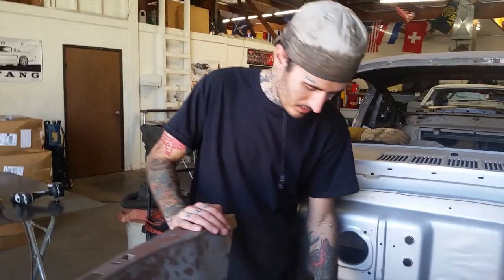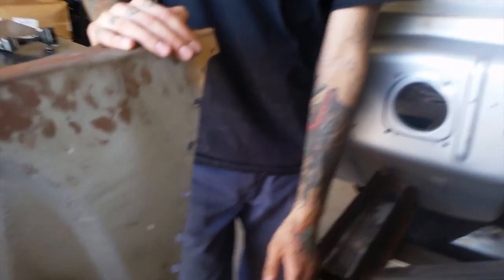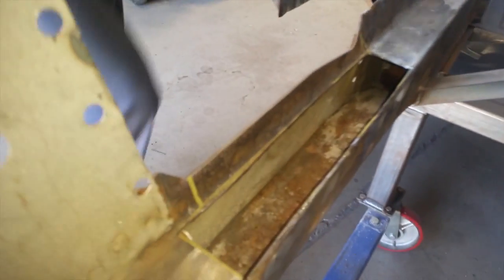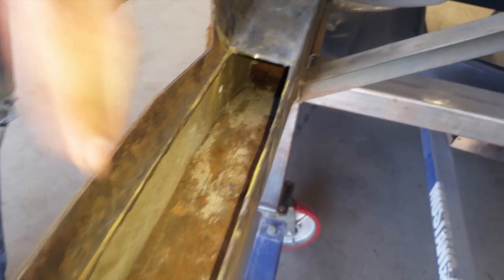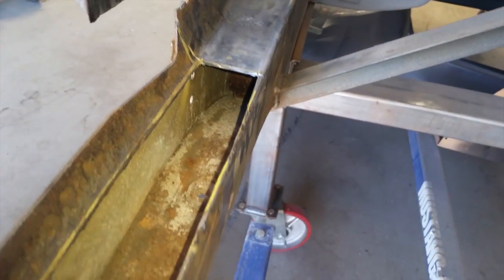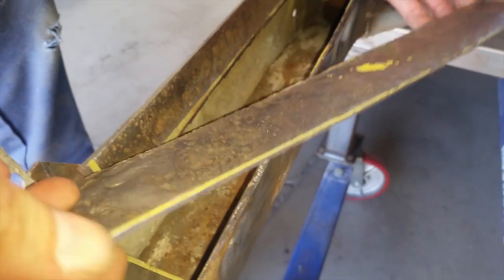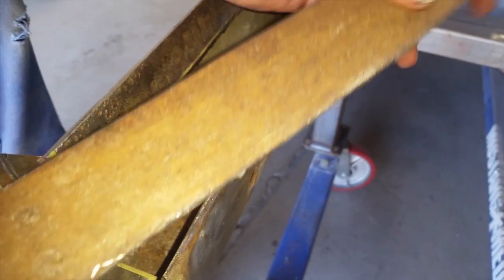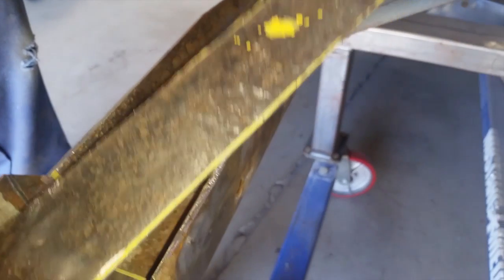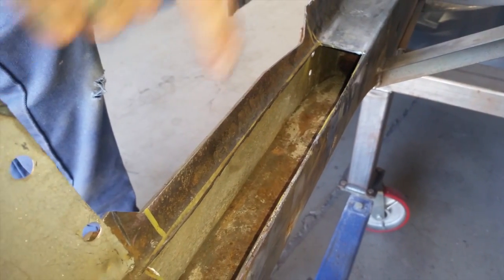Alright Casper, there's a little part two for you on the rust on your frame rail on the passenger side. We got a little look inside here before I close it up. There's rust of course, but it's nothing too crazy — this would be the inside of the piece that I cut out. There's light rust, no pitting or anything, not like what was on the outside. So I'll spray some stuff in there and we'll close it up.